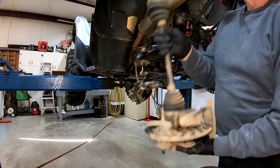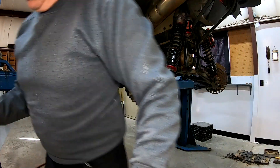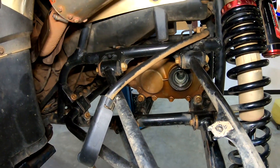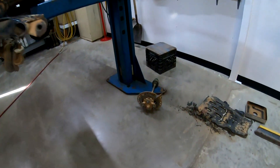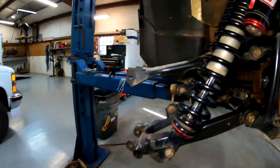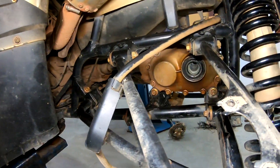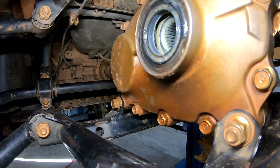There we go. See it's just a snap ring, snaps in just like any front wheel drive car. And there's our seal. I've got both axles popped out now — there's that side, that side. But I think I want to show you guys: if you're ever going to do this, you need to pay attention. You need to look at how deep those seals are set into that rear diff.